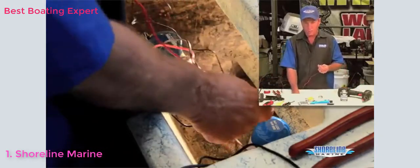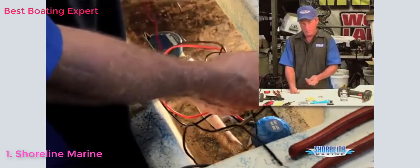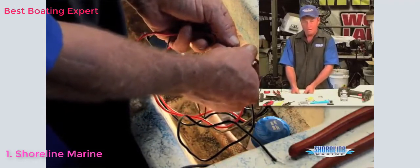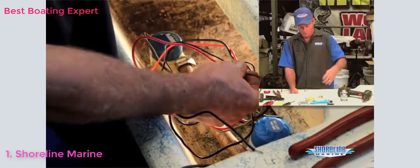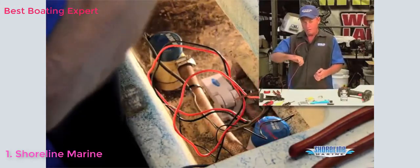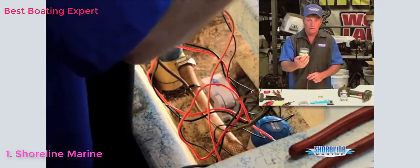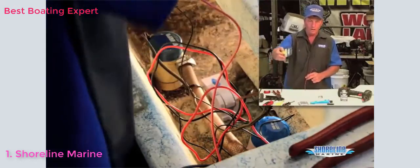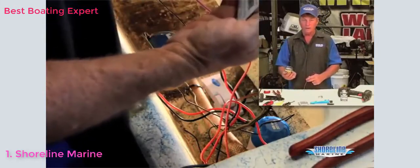And then off your switch coming from your console, the brown wire normally, you'll connect all three of these wires together for your B positive or battery positive. That's your power going to your pump. Your other black wire coming off of the float switch will go to the positive wire that we've already run up to our battery that'll have a fuse in it, usually a 7.5 amp fuse, which will protect your wiring going all the way up to the battery in case your pump shorts out or you get a nick in a wire and it grounds out.